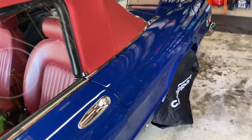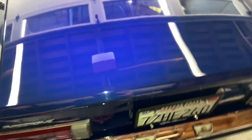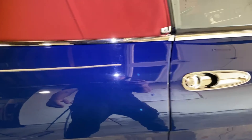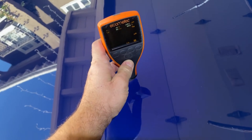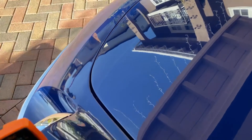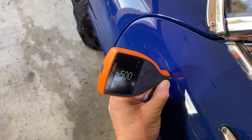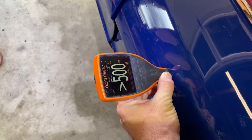Here's how we're doing so far — it's already looking better now that we've hit it with clay. Let's take a look at how swirly this thing is on this repainting. It looks pretty nasty, so we're going to get rid of probably 60% of these today, maybe more, and really gloss everything up. Since it was repainted we're going to get out the paint thickness gauge and check the readings. As usual on a lot of repaints the readings are all over the place — some are off the chart, some are really low. Thankfully it's a two-stage paint job, not a single-stage.